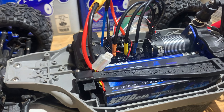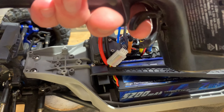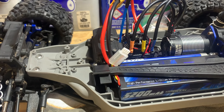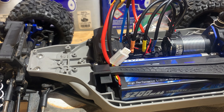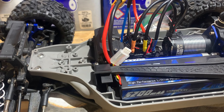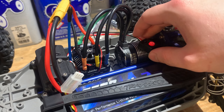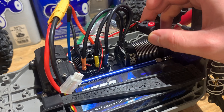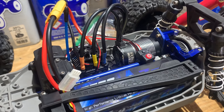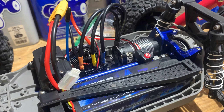It's definitely going to need some calibration because there's no reverse. I'm going to look up how to calibrate this thing because I'm not great with HobbyWing calibration. Okay, so I just got done calibrating it — it really wasn't as hard as I thought. I set neutral first, then full throttle, then full brake. I also had to do a little adjusting on my radio because it was off a little.